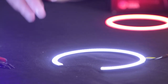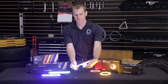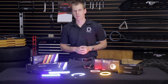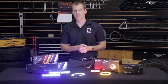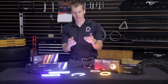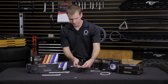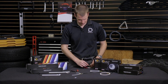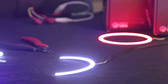Power that up and you'll see we're still lighting it up with no problem, even with that area missing. So you can cut up to 20% off without changing the driver power level. If you need to change the driver power, no problem — we offer additional drivers on our website at a small charge so that you can cut down as much as you might need. If you have a situation where you need to cut off almost the whole ring, you can do that, swap out the driver to a lower power level, light it up, and you're back in business with your totally custom and unique shape in no time.